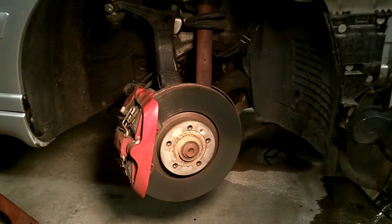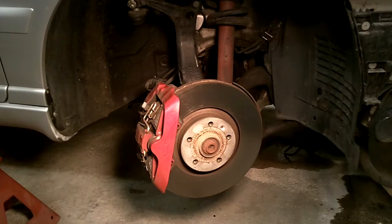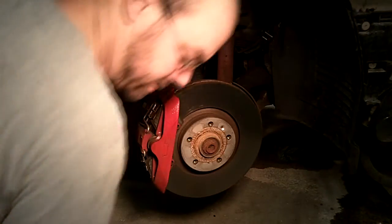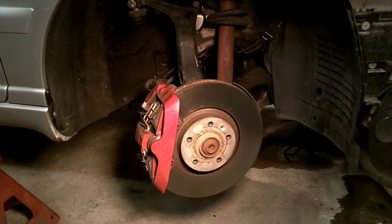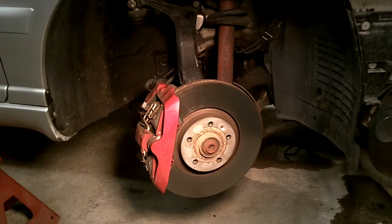I'm going to go check my regulator pressure that's running to this gun, and I'll be right back. So my regulator for my air compressor is only giving me about 90 psi, and I want to pull like 130 or so. So I'm not quite sure what to do about that. I mean, this is a 1/2 inch gun, this thing can handle it. So that's part of the problem. My regulator is supposed to go up to 160, so I'm not quite sure why it's only going to about 90.